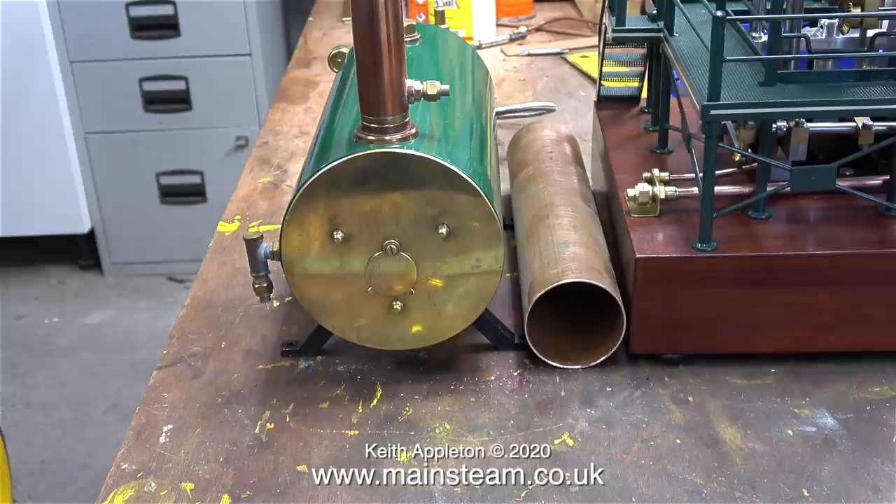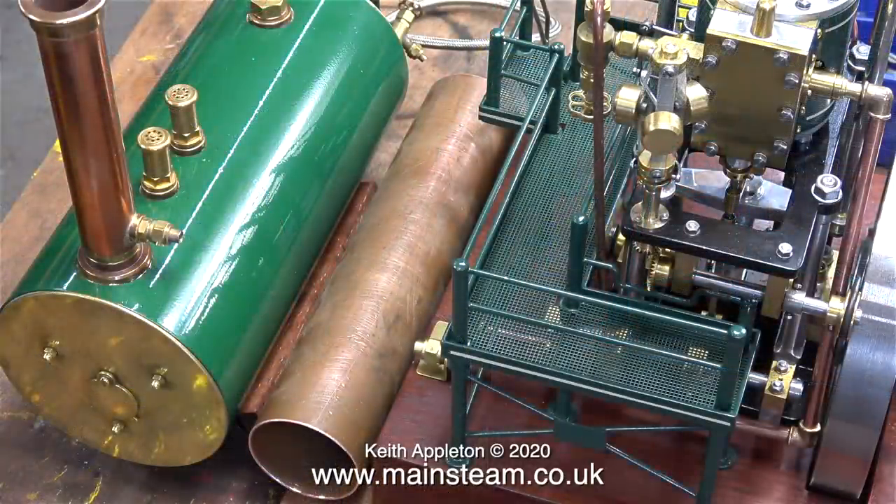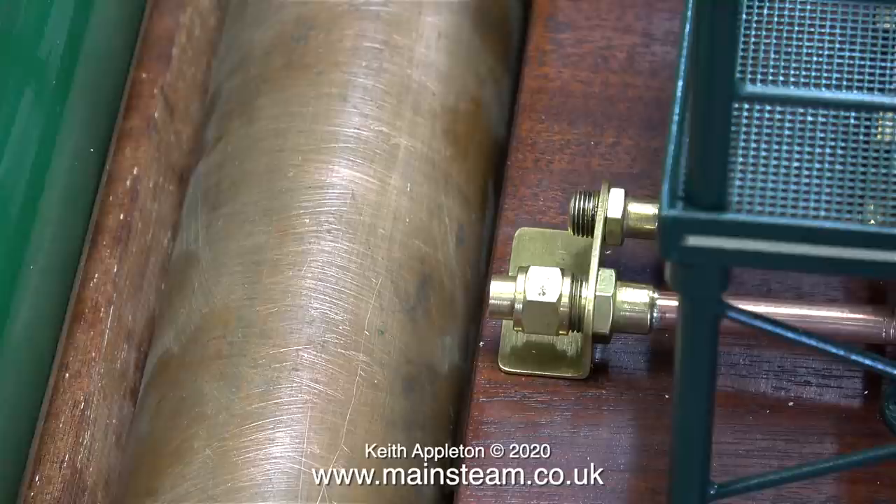After a while the carbon monoxide detector was back in place and everything was fine. It's time to have a look at the condenser — I've ordered a piece of copper tubing from Black Gates Engineering. This is a temporary piece of tubing I'm just using for ideas. I've ordered a piece of 16-gauge copper tubing, two and a half inches in diameter and nine and three-quarter inches long. The condenser I propose to make for this plant is going to be a horizontal one rather than vertical.